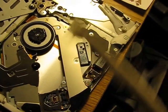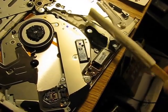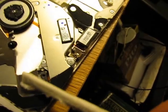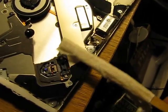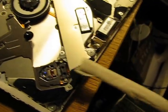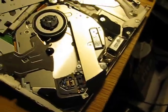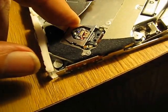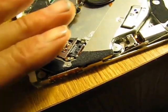If you can't get it done this way, then you have to take the machine all apart — pull out the optical drive, take the cover off, and then manually clean it. But you can do this this way. I've done it. Just put the stick in, go around and around, and pull it back out again. It's about an inch and a half in, on the lower part of the optical drive.